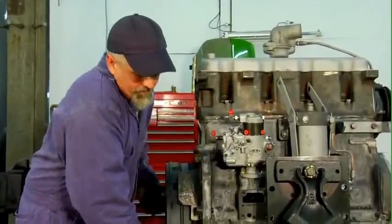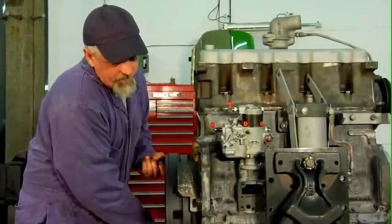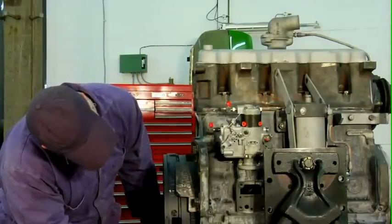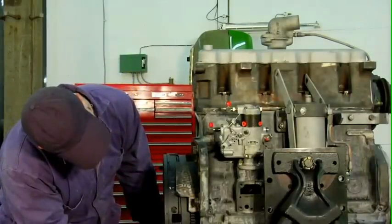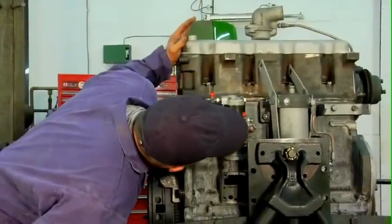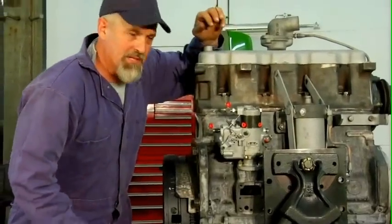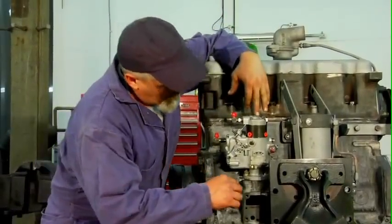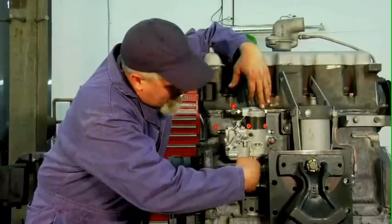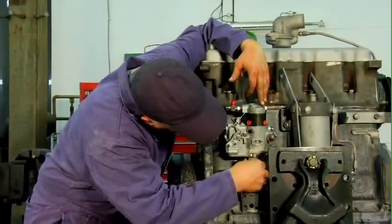Let's snug down and roll backwards. Pull it back up to four degrees before top dead center. Right there. Check our timing window, and the pump is dead on — we have it just exactly where we want it. I'm going to finish tightening up these nuts, and we'll call the pump timed.